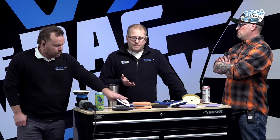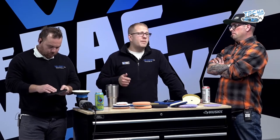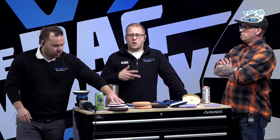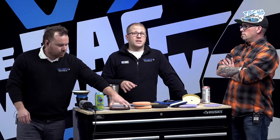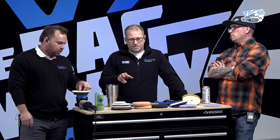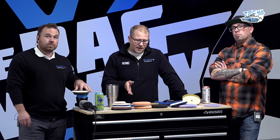And I would say there's two secret nuggets. The black microfiber is great for metal polishing, especially soft metals. So your aluminum, your brass, anybody that's doing bright work, concours work, stuff like that, you'd be really, really surprised. I did a significant amount of testing with soft brass and aluminums, and hands down, that pad is the best you're going to get out of anything that Lake Country offers. So I think that's probably the biggest thing there.